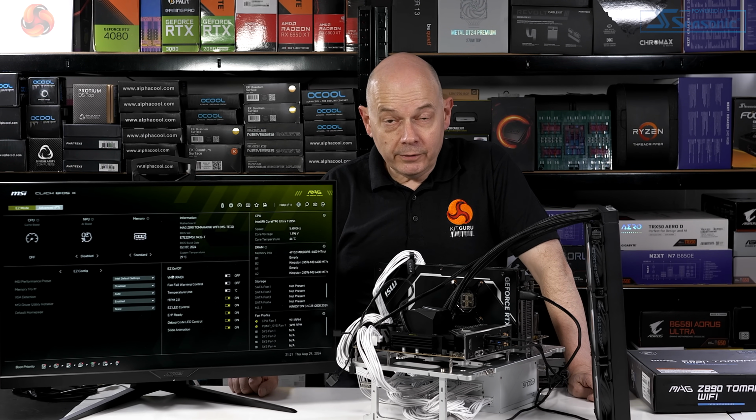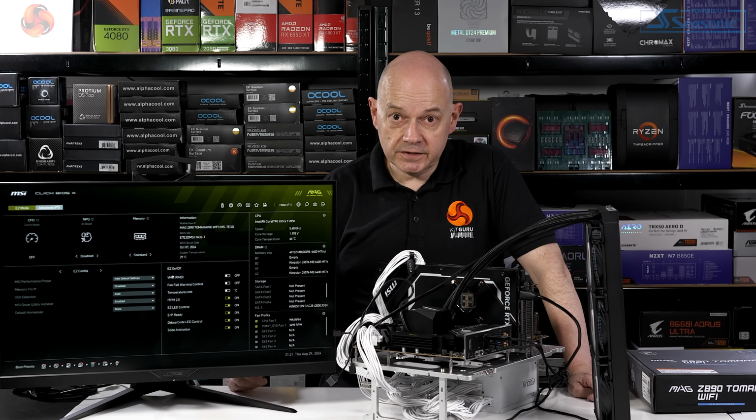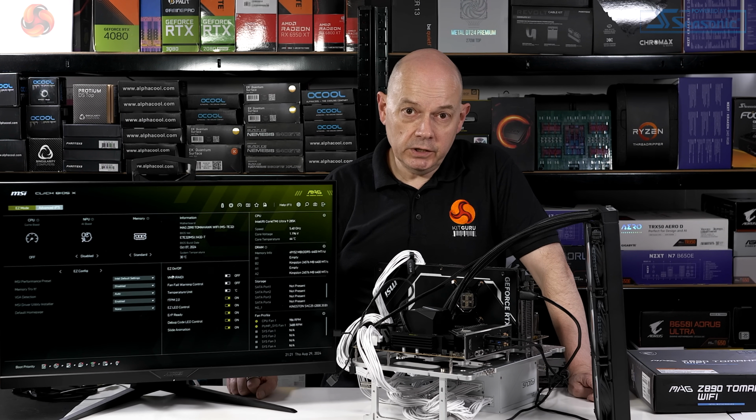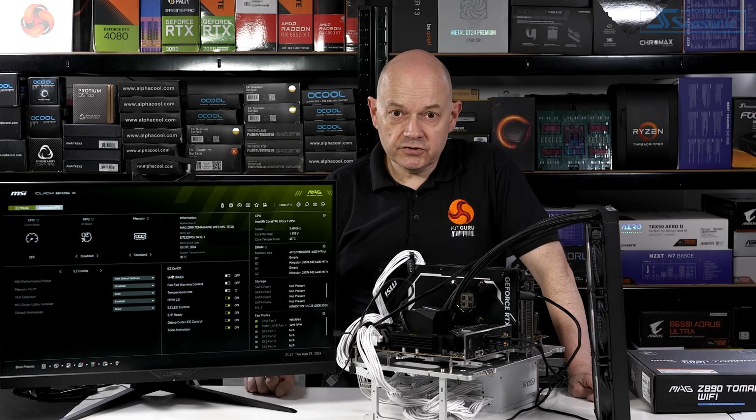What happened apparently is that MSI shipped a number of motherboards out, hopefully only to reviewers rather than to retail, which only recognized engineering sample processors. They don't recognize retail processors, and that's what I've got, retail processors. Never had that before, a brand new platform that does not recognize the brand new processor until you update the motherboard. Okay, so once you know that, the update's nice and straightforward.